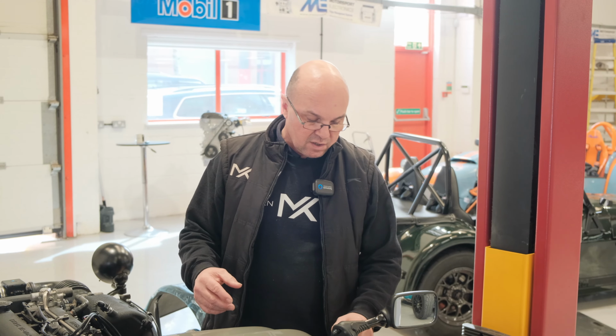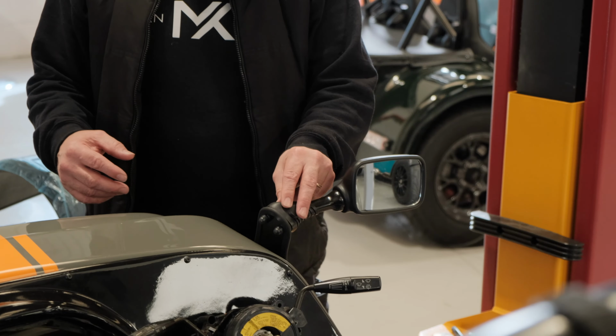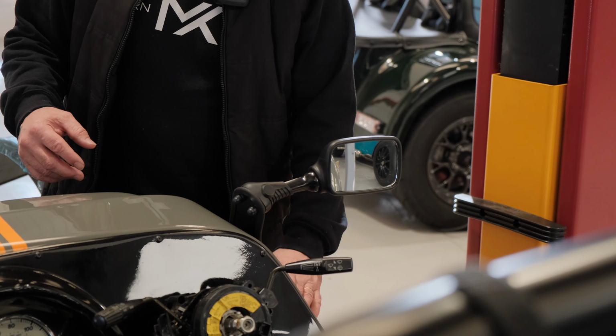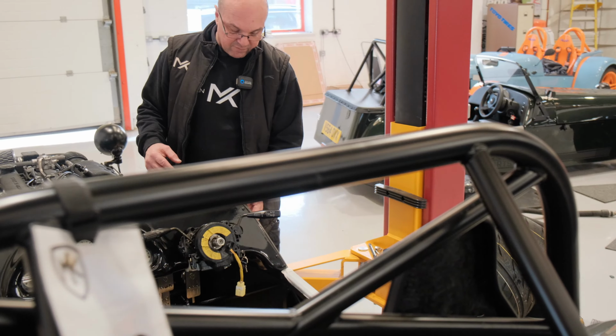Now if you're going for a windscreen afterwards and all of that side of things, we have these little wing stays that are made of dummy ones that bolt on the wing mirror, and then these bolt into the same 2 hole fixings which are here, which again the manual that's in there, it's a 70mm up by I think it's 130 dimension where they go.